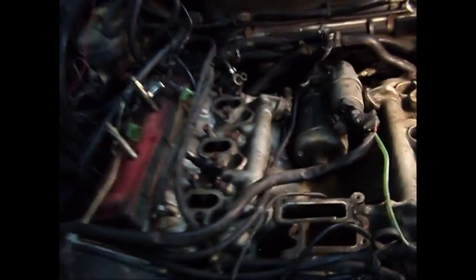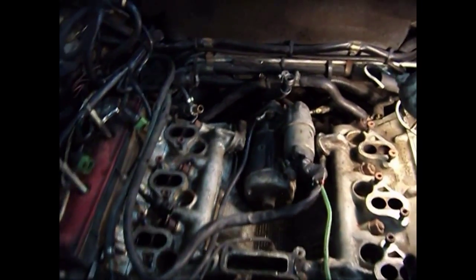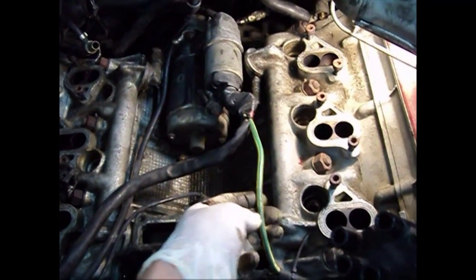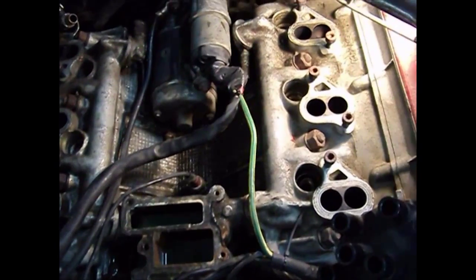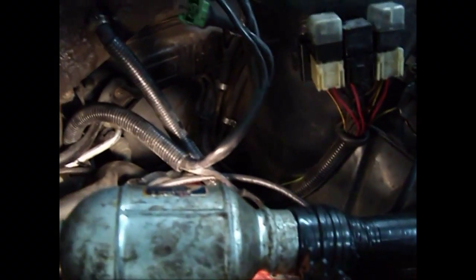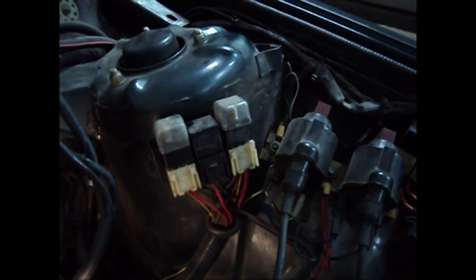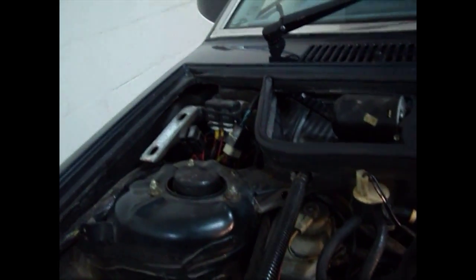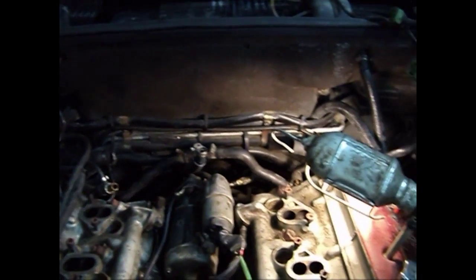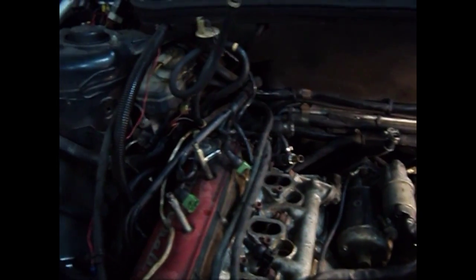As I mentioned before, I will have to take out the whole wiring unit, dismantle it, and rewire it completely — avoiding household-type wires. Even though multi-strand wire might still do the job, it's preferable to use proper auto wires for the sake of color coding. I'll use a color for live, a color for ground, and each signal wire will have its own independent color. I'll also draw a schematic so anyone can easily understand the wiring afterwards.